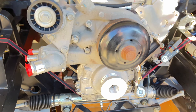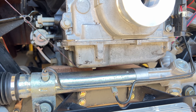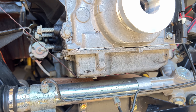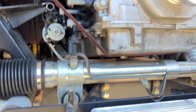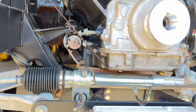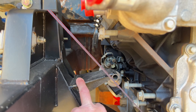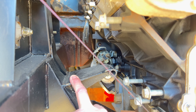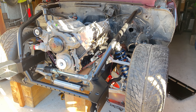The engine's going to sit a little bit lower because I've got to get a different oil pan for this. This one's just not quite letting us get down to where we want to go. She's just hanging off the strap and off the wooden block. The oil pan sits below the bottom of the crossmember, so that's no good. I've got to cut these motor mounts off — the ones that came with it — because they're just not going to work. The motor's coming out almost right away. I just wanted to get it in there to see how she fits.